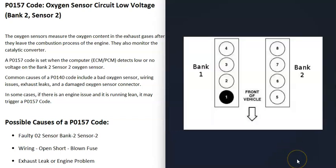When you have a V6 or V8 engine, the engine is going to have two banks. Bank 1 is always the side of the engine with the number one cylinder, and the opposite of that is bank 2. If you Google your engine and look up cylinder location or firing order, you can find the number one cylinder — that side is bank 1, and the opposite side is bank 2.